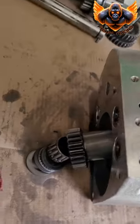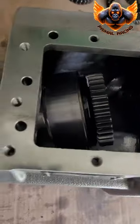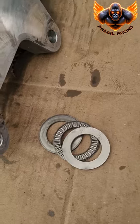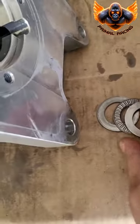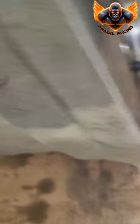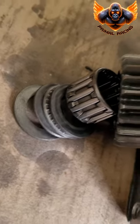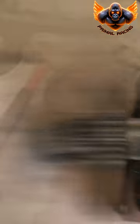After you remove the cluster shaft, this is the cluster where your clutch packs are — it's the last step in the case. I'm using the assembly guide in reverse order. There's a thrust washer pack: it's a washer, then needle bearings, then another washer on the front. On the back you have two washers, then a needle bearing, then a washer, and then the rest of the assembly. You want to take good inventory of what you have and make sure it's all there.